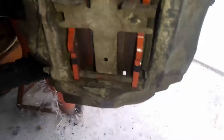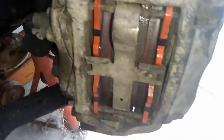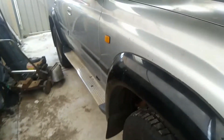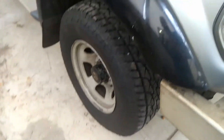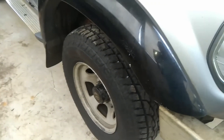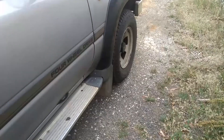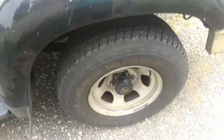So, bolt's cut. There's one, and there's the other one down there. Pads refitted properly. Now what I'm going to do is straighten the wheel back up, put the tyres back on, and go for a spin. Car's off the jack. All done — redone that side, checked the left side, left side's perfectly fine. So now I'm going for a spin. Well, done. No grinding. No nasty burning smells. Nothing. Engine's hot, but it works. So, I have fixed the brakes.